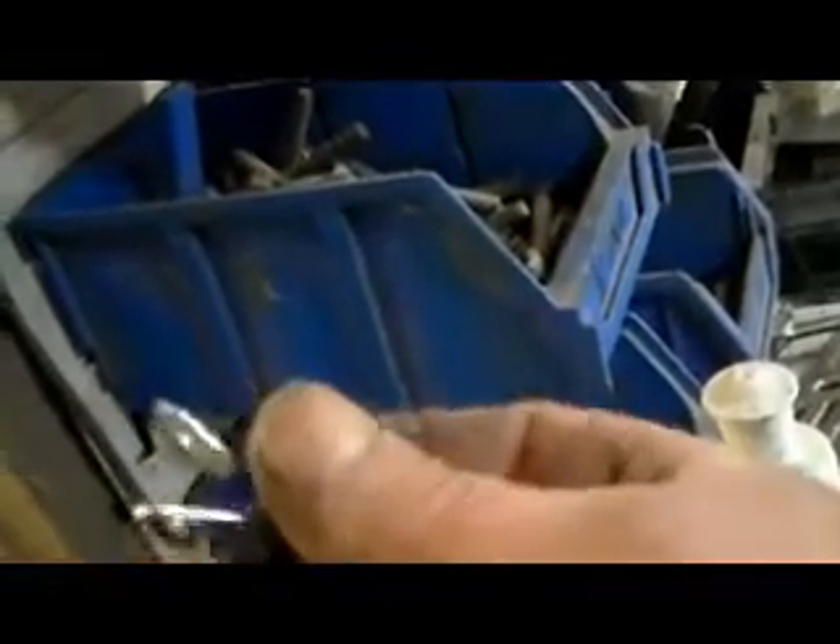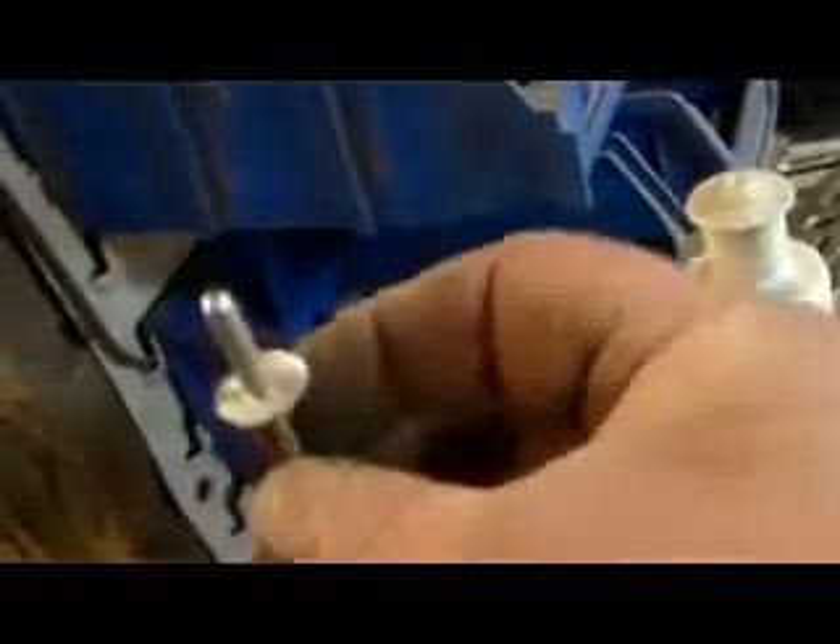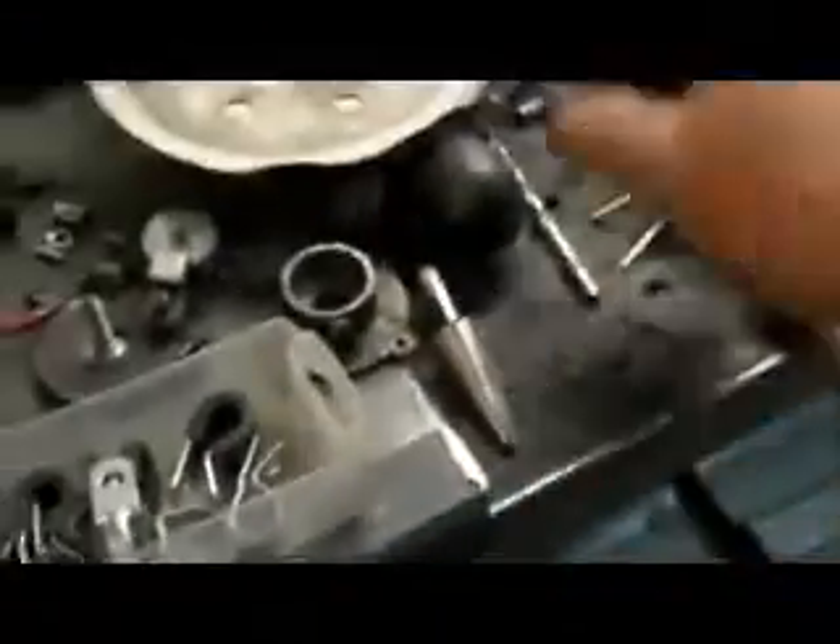I've got my battery cable just loosely pulled into the boot - into the trunk of the car. I've got a grommet there ready to put in the hole. I'm going to use these little P-clips along with these little rivets - they've got a nice big head on them - and I'm going to run along the car starting up the front end, dropping the rivets everywhere. I've connected them already to my starter pole and I've got one P-clip connected - that's the cable from the starter motor - so I'm just going to run it down the bulkhead.